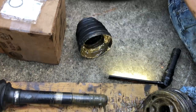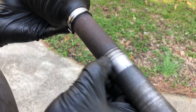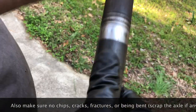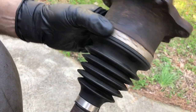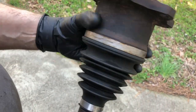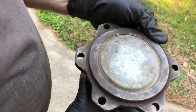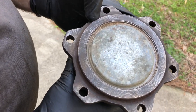Alright guys, we've got this side of the shaft prepared. We've cleaned it off with mineral spirits and taken a wire wheel to the seal of the top part of the boot, and we've made sure we've got no damage — there's no deep corrosion on any of the parts here. The reason this is all shiny is that the broken piece of rubber has just been rubbing on here for a long time. We've got a little bit of cosmetic corrosion on this swage clamp for the rear boot, but the rear boot is fine. This whole thing never made any noise — it was just that we caught this during an oil change. I've started wire brushing the inside flange area and we want to take this back down to bare metal, then treat it with a rust preventative.